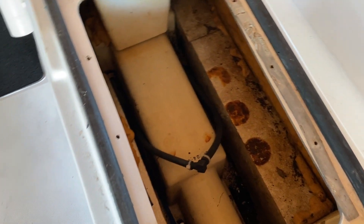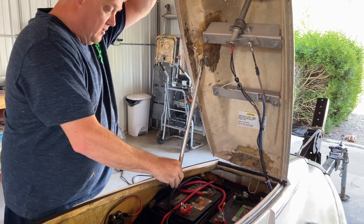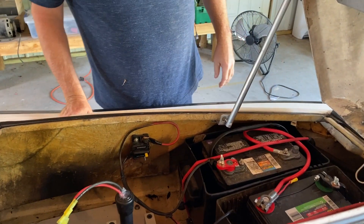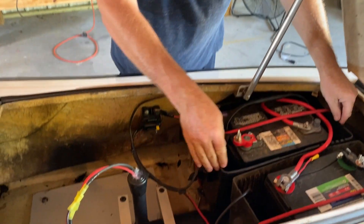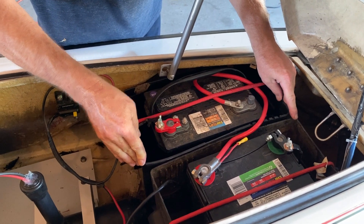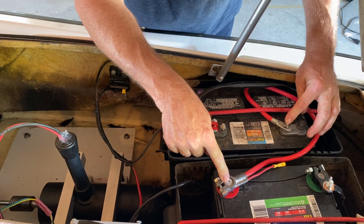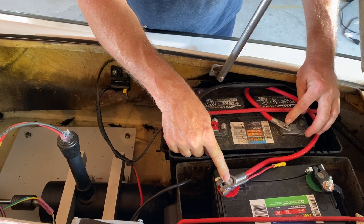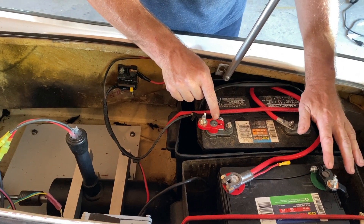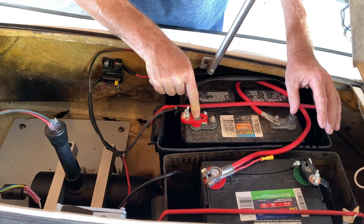I'm going to open the inside. As you pick it up and put the latch on, you can see on the inside we have two batteries — two 12-volt batteries. These 12-volt batteries are hooked up with positive and negative to each battery, which puts the opposite terminals as your positive and negative going to the motor, giving you 24 volts.